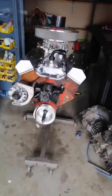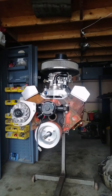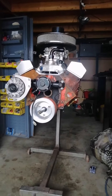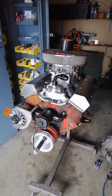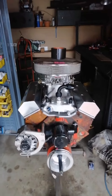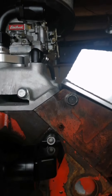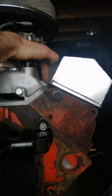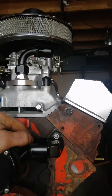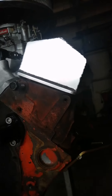But they were freebies, so that's awesome for me. It finally gave me an opportunity to see what the intake and valve covers would look like on here together. Something that happens when you buy chinesium stuff — that intake, I'll say it's a Pro Comp intake which is the epitome of chinesium — and the valve covers I think are from the same company. I've run into an interference issue, which is the casting right here for the intake runners. It's a little bit proud of the mounting surface for the valve covers to the cylinder heads, and also the valve covers are a little bit wide all the way around.